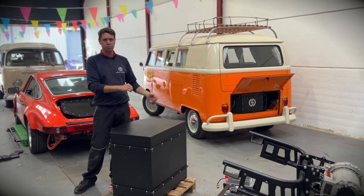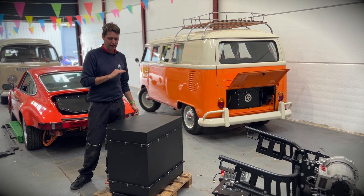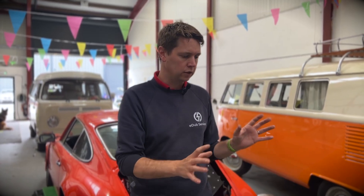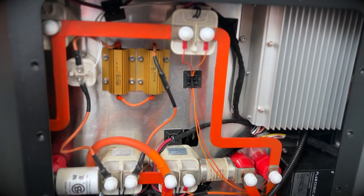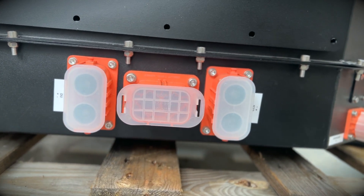The vehicle's still a classic camper, so driving 170–180 miles in one go is almost too much anyway. It's fun, but then you just stop and rapid charge in 45 minutes — no big deal. The battery box contains not only batteries but all the other safety connections within there as well. Behind the access hatch on the very front is a board covered in high voltage contactors to keep the vehicle safe. Even though this is a fully capable pack, the high voltage sockets are not live, so the system is safe for shipping to international suppliers and also during the installation stages.